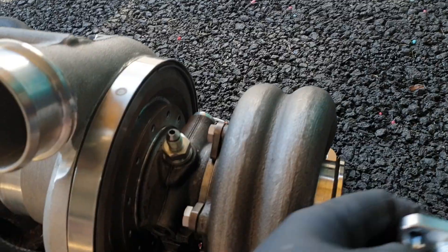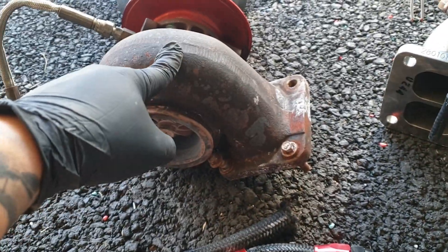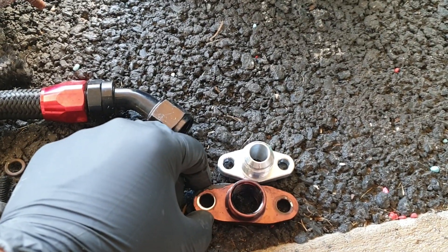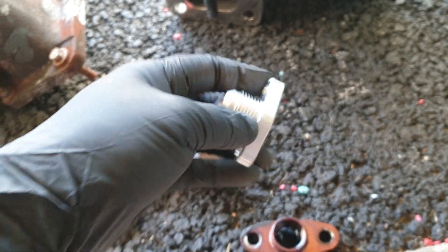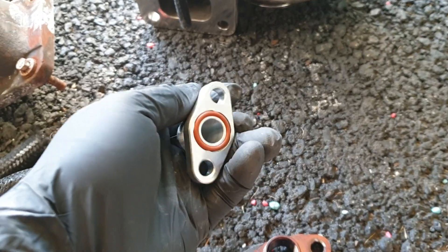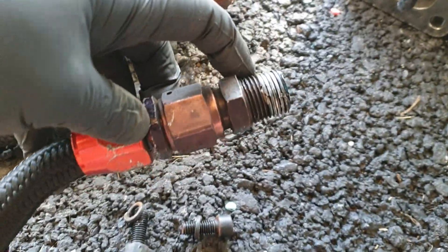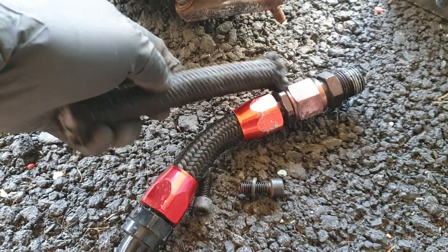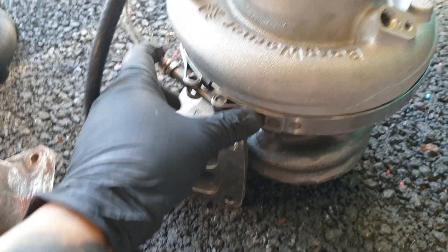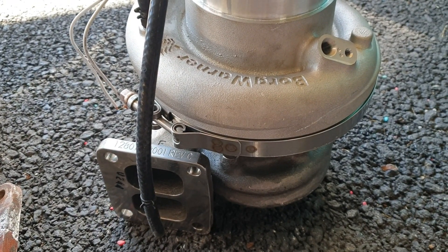These come already with this fitting on top. However, it didn't have the bottom one, and I wanted to show you the comparison. This was the one I had on the Turbonetics T60, but as you can see it was too big. So I ordered this one. All the parts I use in my videos, I always put the link below so you guys can benefit. This one has an O-ring already, so you don't need silicone on the bottom. So I have to remove the old fitting and attach the new one, which will shorten the length of the line. I had a 10AN around so I'll have to recreate the line, but that's not a big deal. I'm gonna use this part to clock the compressor housing the way I want it to fit in the engine bay.